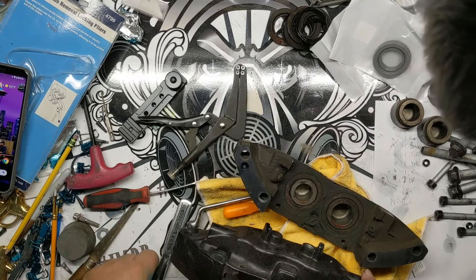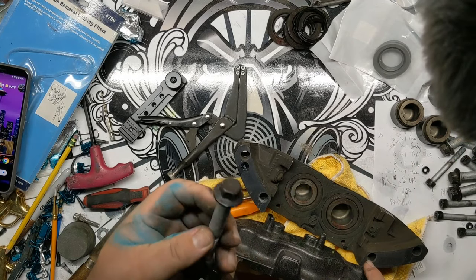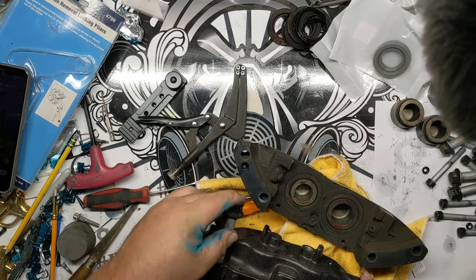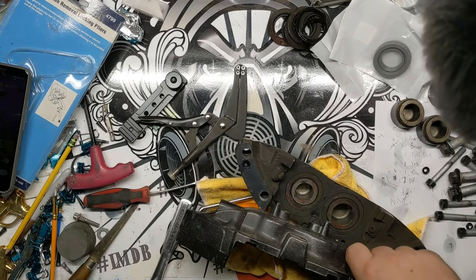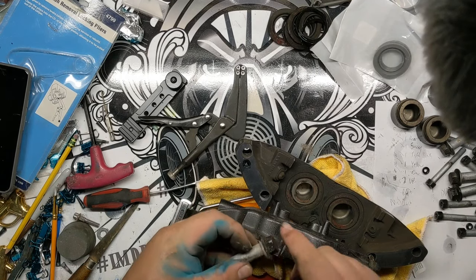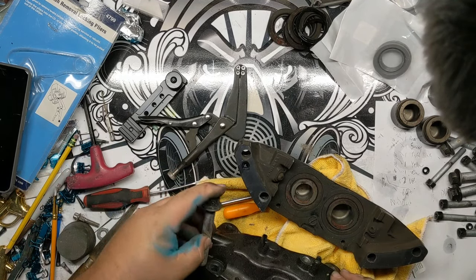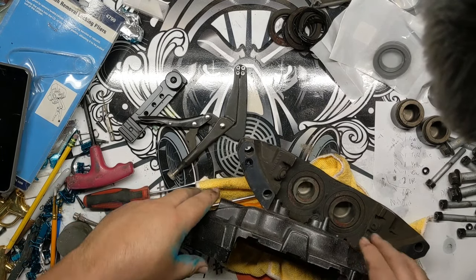You need a 15 millimeter to pull the bolts out. These bolts right here hold the calipers together. Those are 15 mil, so make sure you get those out. These are all coated and finished, assembled. That's why parts of the bolt head aren't coated. I coat them separately, as you'll see here shortly. So yeah, we'll keep moving forward.